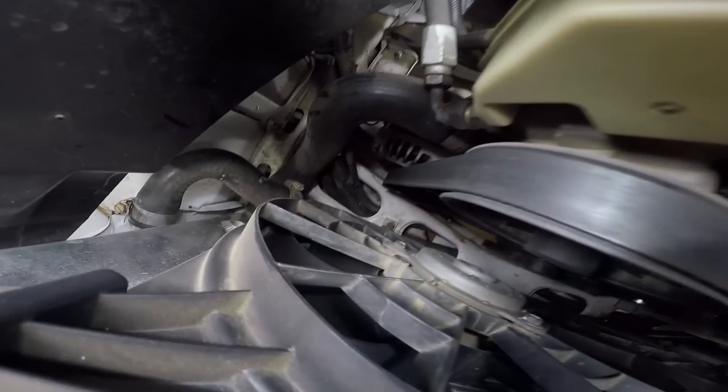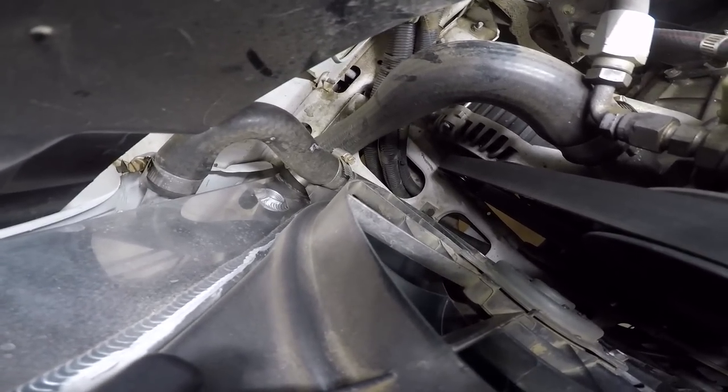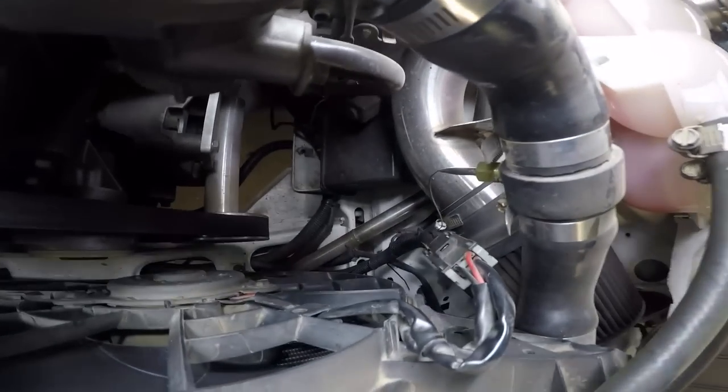And I don't know if you'll be able to see, but there's actually an inch stainless pipe that runs below the thermo fans. This is the inlet for the radiator off the coolant reservoir. Because it's E-series and I put the coolant reservoir on the other side, it's got this crossover pipe which runs up above the intake and then to the coolant bottle.